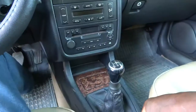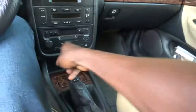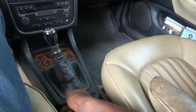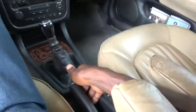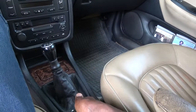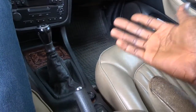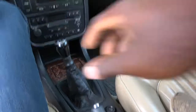The weight of the car needs to rest on the brake, not on the transmission. If you release the brake pedal and the clutch before pulling the handbrake, the entire weight of the car will rest on the gear. The brake is no longer holding the vehicle — it's the gear doing the work. The next morning, you'll find the gear lever very difficult to pull out from gear one. Likewise with automatic transmission, it will sometimes be very hard to shift it from park to drive or reverse.